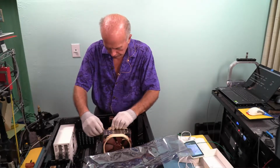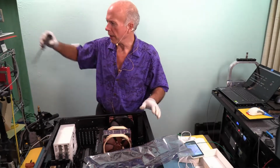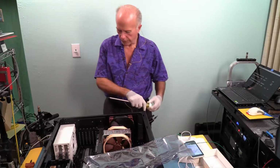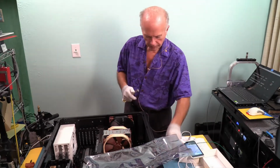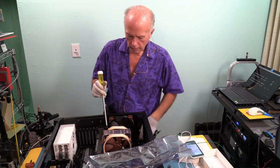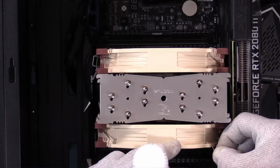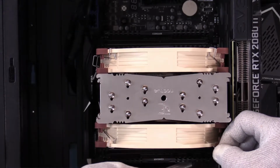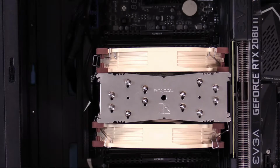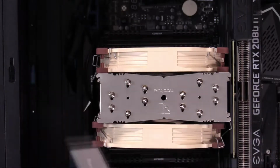So what we're going to do is another little trick where we will take the clips off the fan another way. This may be a little bit faster. I need a straight blade and I need a long screwdriver. So I'll get my tips out, and right here I've disconnected the clip at the top, and I've got to disconnect the clip down here at the bottom. I'll use a smaller tip. That was a number 2, this is a number 1. Okay, that clip is off.